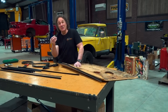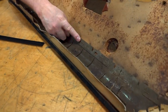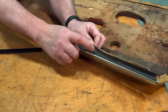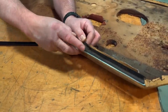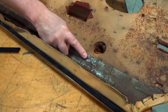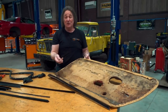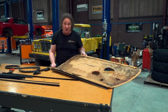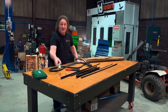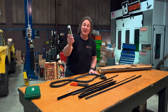If your window felts are held in place with staples, you've got some work ahead of you. Staples are not only a pain to remove, they also require a lot more work to put in. Basically, what you have to do is drill a couple of holes in the metal backing so the staple will stick out through, then you put it through the panel and take a tool and flatten the other side of the staple. That's a lot of work to put a staple in. It's possible to do it this way — sometimes you have to for a Concours restoration.